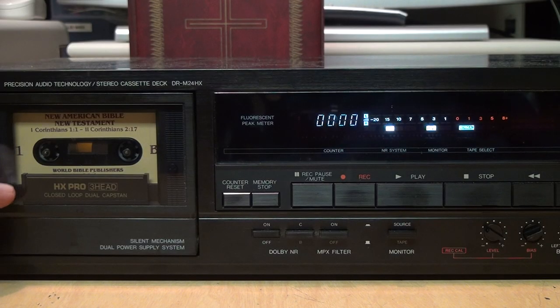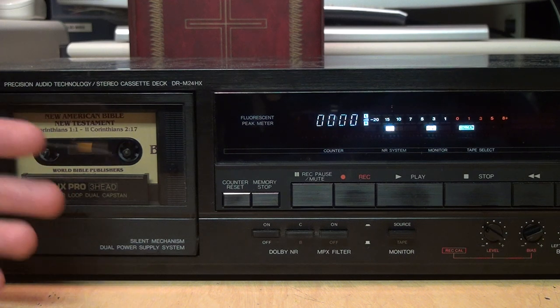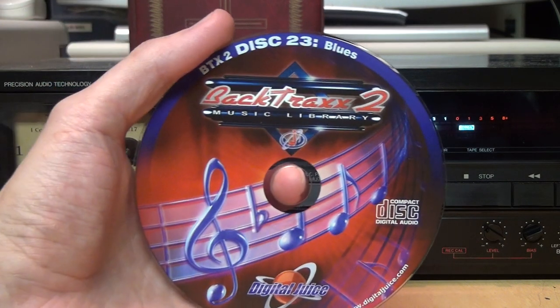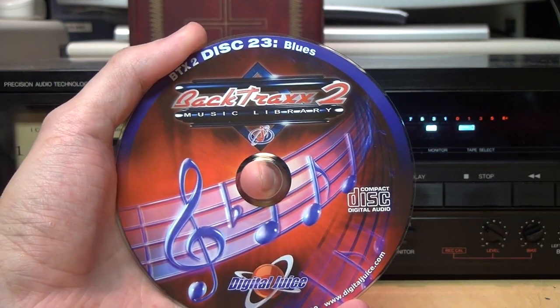Here's that tape with the clear leader, and when I calibrated it, it did require slightly more level than the first tape, but the bias was the same. So I'm not sure if that's different tape stock or if that's just part of the normal variation from one tape to the next. And I recorded another track on it from the Backtracks music library, this time Cosmopolitan Blues,